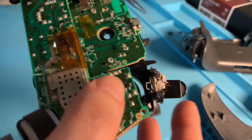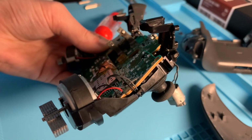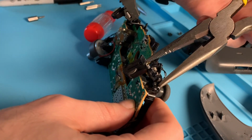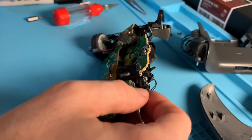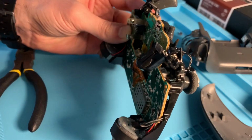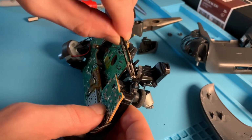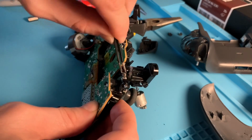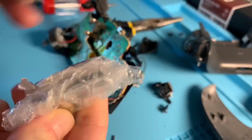As it was drying, I used a little paper clip to help spread the glue and let it hold up a little bit longer. And so it was pretty good. I mean, it worked well, but if you focus closer here, this is what I did to get the shoulder button off. I used a pair of pliers. So you could try something else, but this worked for me, and it pushes that little bar out because it's in there pretty tight. I wasn't able to pop it open with my hand, so it just got it out so that I was able to pull it then with this pair of tweezers and push it the rest of the way. You may have other tools that would work, but this is just what worked for me to actually remove the whole piece. And you see it just dropped out there.